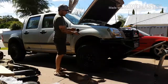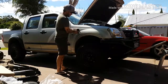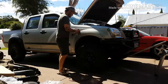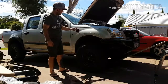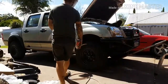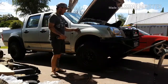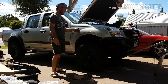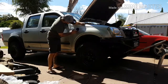It comes with this rubber to go around the hole, but I'm not going to use it because I reckon it supports rust — it holds moisture inside and before you know it'll be all rusted. So I'm just going to put a bit of paint around the edge and a bit on the holes. You can just brush it on — you can use primer as well, but you kind of want something that seals, like a clear coat. I'm trying to use acrylic silver, which should work alright.